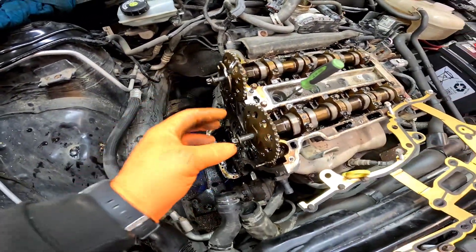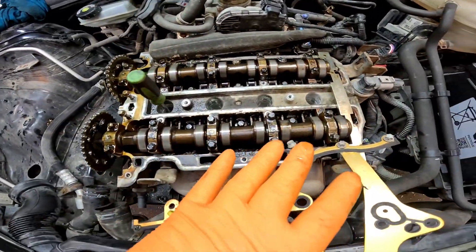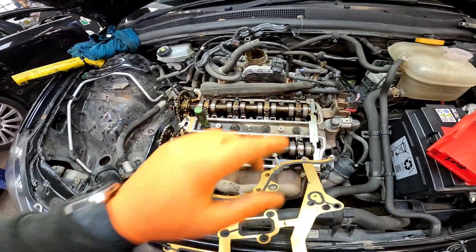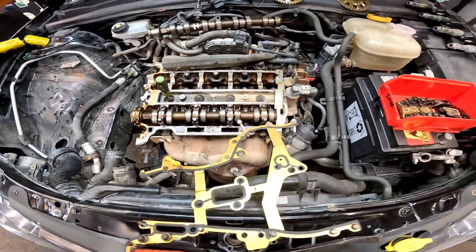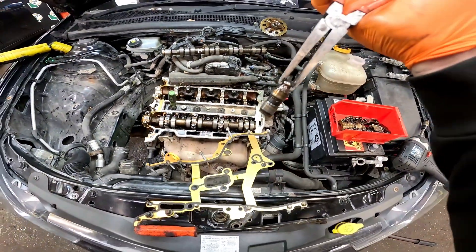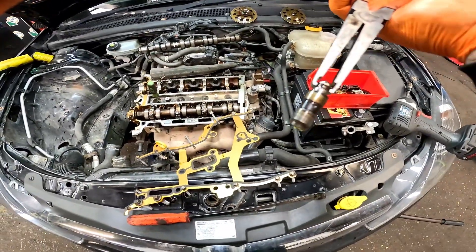Once all that timing chain is off we can remove the camshaft pulleys - an E12 or E14 - get them out of the way, then remove the E10s on the camshaft carrier caps. Get yourself a little label on the inlets and as you pull each one off put them in order neatly, because you do not want to get them mixed up. That is one inlet camshaft removed. We've also removed the rocker arms and we need to remove the hydraulic lifters too because we need to empty these - if we don't empty them you won't get the right valve clearance and they can run like a bag of rubbish, or you might even lose compression.